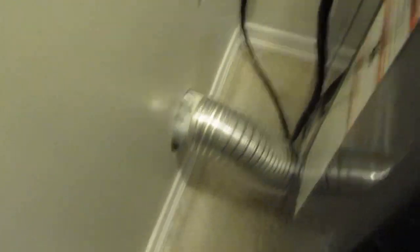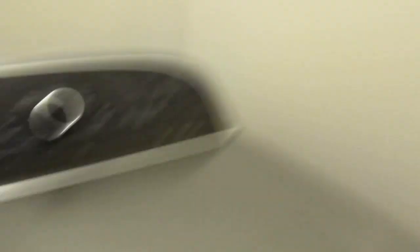The old fuse was blown, so I took it off and put the new one in. The good news is when you're installing one it's way easier to get the wires on than it was to get them off — it just clicked in. I've got all the lint cleaned out, the thermal fuse replaced, and I connected the semi-rigid metal duct vent to the outside. I plugged it in, tried it — and there was still no heat.